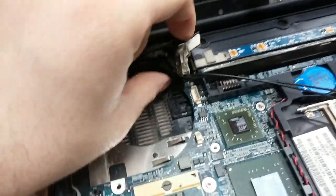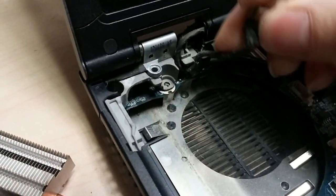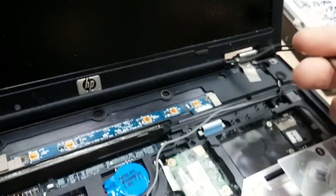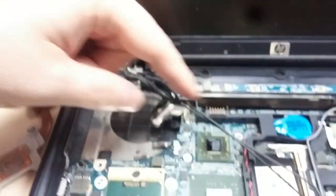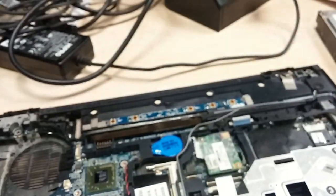I got the hinge screws out. Just got to get the wires out from underneath the frame. These are the other wireless wires. If this one has a webcam, there'll be a USB wire that comes here and plugs into the motherboard somewhere. If they have microphones or something, there'll be wires plugging in down here. This one's pretty easy so it should lift right up and come right off. We're done with that — put the screen aside.